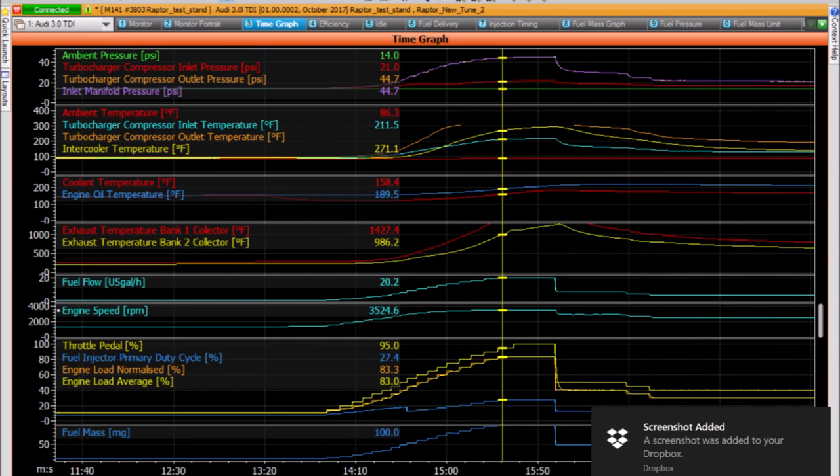All kinds of progress this week — loads of parts laid up. And a little more info on the engine: someone was commenting that 20 gallons an hour is a bit high — basically that's the full, full, full power setting. We're pushing way too much fuel into the engine right now, as you can see on this screen capture from the last run: 20 gallons an hour running at 44 psi, which is quite high. That's not going to be like that in the actual aircraft. I'm going to be limiting the boost so it doesn't go that high.